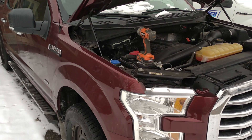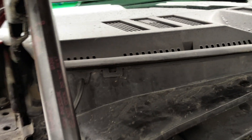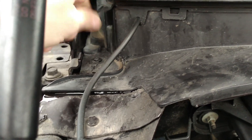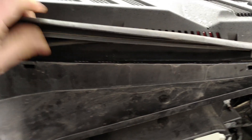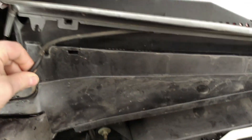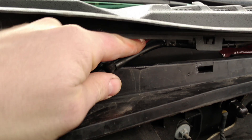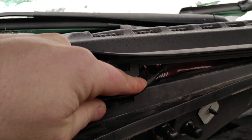The first step is to pop the hood of your truck. You're going to see some tabs here — you'll see your windshield washer line going up below this cover. Basically you want to pry open this tab, and that should be all you need. Once you've pried open those tabs and lifted up the cover, you'll find the windshield washer line — just pull it down until you get to the Y section.